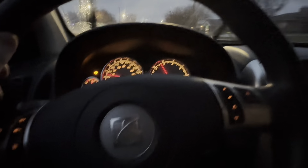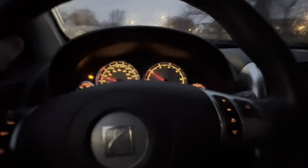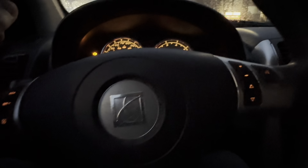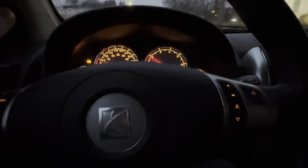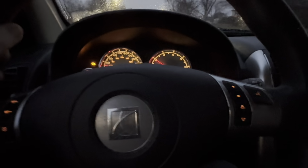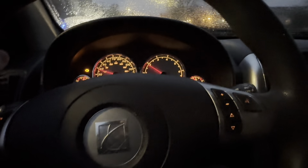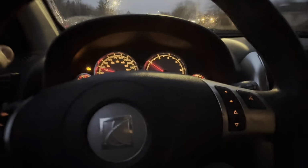And hopefully you can hear as we get up to about 40-45 here, you can hear that wheel bearing coming into play in the left front. If you can't hear it now, we have a couple of turns, one to the right and then one to the left, like kind of gradual curves. You should hear it as the car turns and the body rolls. Especially this first one, it'll load that left side wheel bearing and it'll start making the most noise.